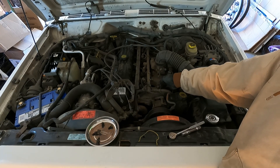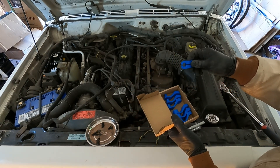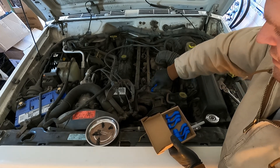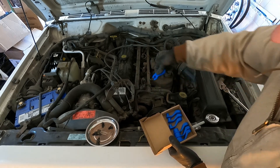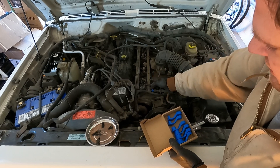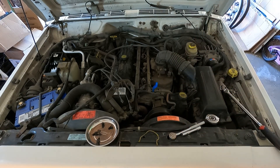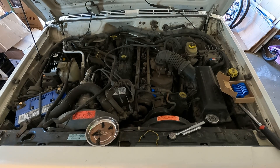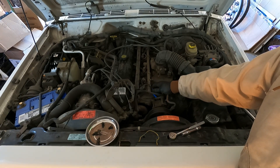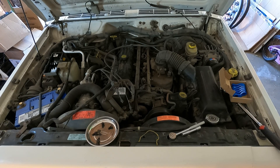So that pops off and it's actually retained here, which is really nice. Then you can grab the right fuel line tool. I have a bunch here and we just find the one that fits inside and pop that off. That might be just barely too big, so go to the next one down — this is 9.5 millimeter. There we go. One thing I forgot to mention is always disconnect your negative battery terminal before you start. This 9.5 millimeter is the right size to remove that fuel line. There's just a tiny bit of gas there — not a lot — but once we get the rest of the rail out, we'll be able to drain all that into a gas can.